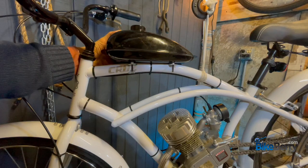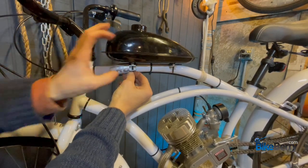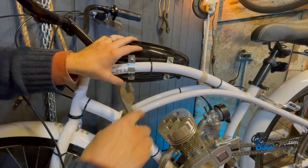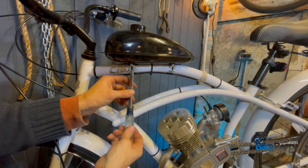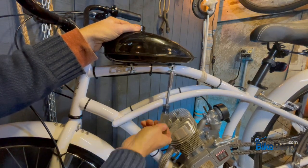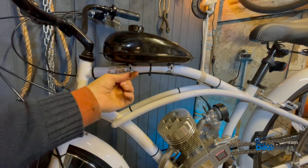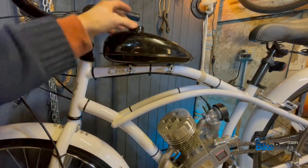The tank is just riding on those four points. Go ahead and put your flat washer, lock washer, then your nut — just get them started. To tighten it down, make sure you have even pressure on both sides, just snug. Again, you're not pulling on the tank like you normally would — all the pressure is against that other nut, so only the bolt is being stressed. That's a pretty solid tank — not crazy tight but snug. No stress on the tank, only on the bolts.